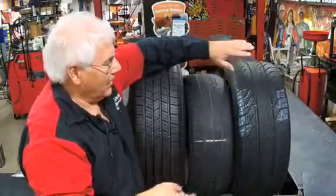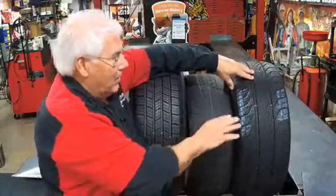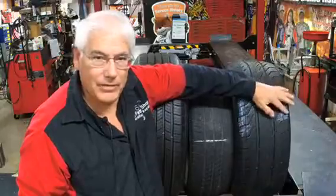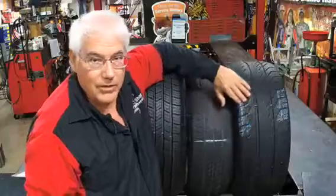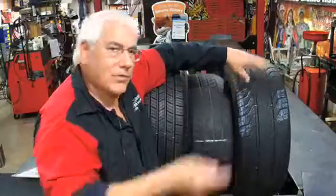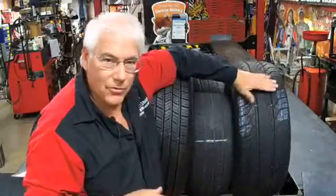So we want to rotate them, and when we do we also look to see if your car needs alignment. On this tire you can see our mark, and on this side you can see where the little grooves are on the outside edge. On the inside edge you can see how the chalk is almost solid because it's worn off those grooves. That means when we rotate these tires, we need to get your car in for alignment so that your tires don't wear like that.